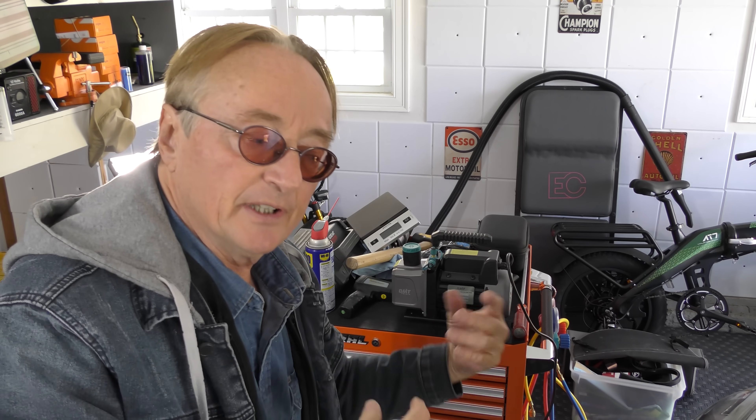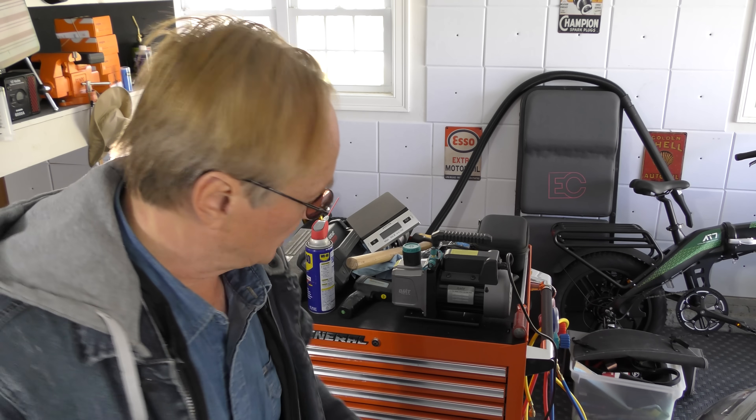If you don't live near a place that'll rent you a vacuum pump, you can buy one. This is a solid metal one I bought on Amazon for about 60 bucks. With mechanics charging 100 to 150 bucks an hour, just buy one. You can even use it on your house AC — it's the same system.